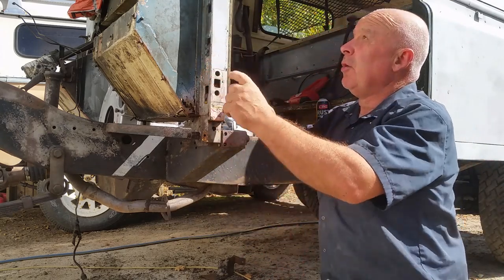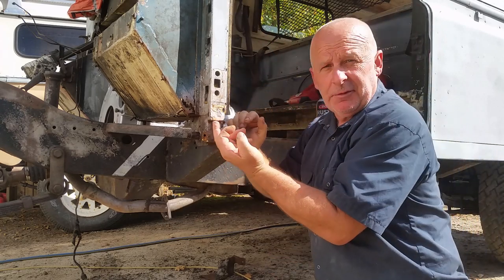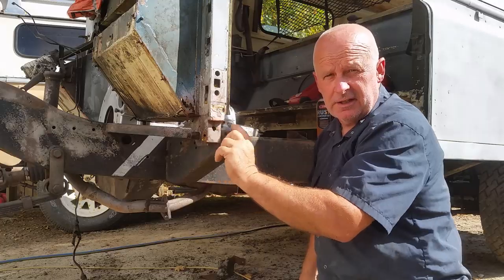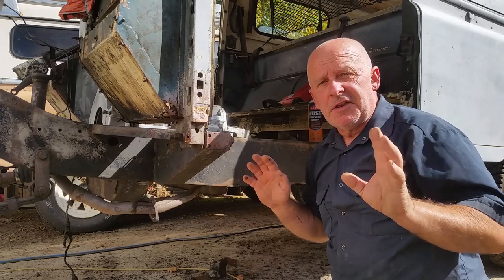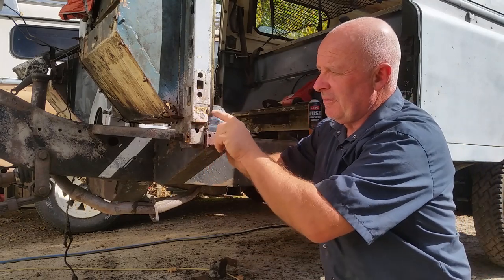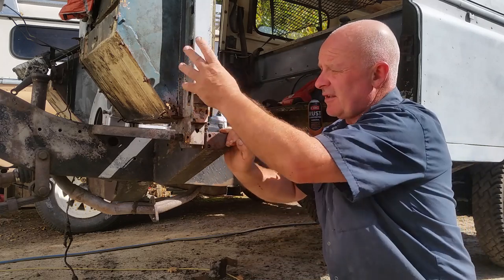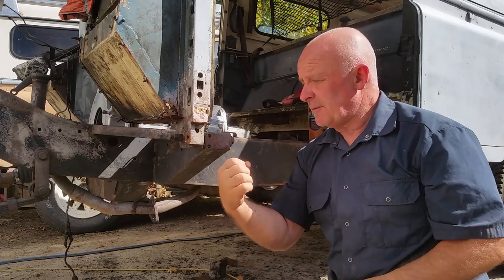Drain holes. Water can get into the top of this pillar, and so it needs to be able to get out at the bottom. In the factory, a drain gap was engineered in just here, but over the years that's plugged up and it's become inoperative. So water has built up in the bottom and it's rusting from the inside out. Why the inside? Because there's no paint in there. These things look lovely on the outside, but quite often up inside the complex parts, nobody's painted up inside there,